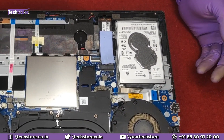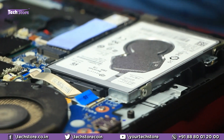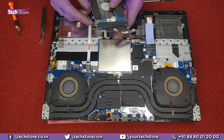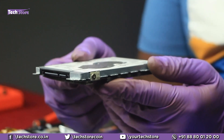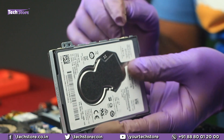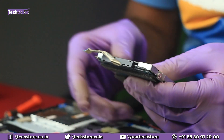This is where the hard drive is. To remove the hard drive, four screws total need to be removed and the casing will come off. You need to remove this particular connector and remove the strip. For those who don't have a hard drive on your Lenovo Legion Y540, you need to buy this connector. You can use a 2.5-inch SATA form factor hard drive or SSD — hard drive upgradeable up to 2TB and SSD up to 1TB. Remove four more screws, replace your faulty hard drive, then fit back this particular connector.